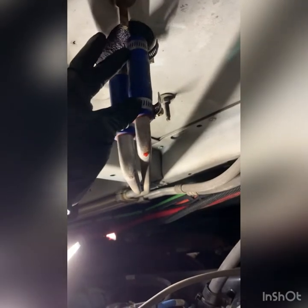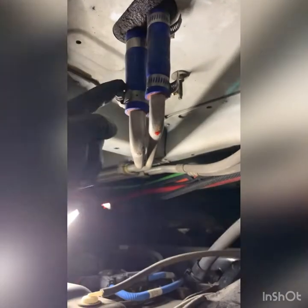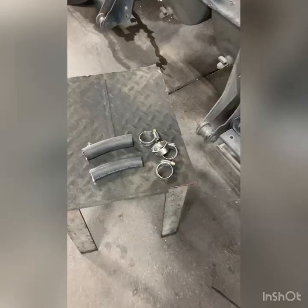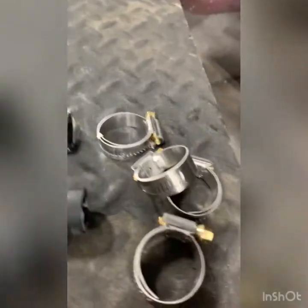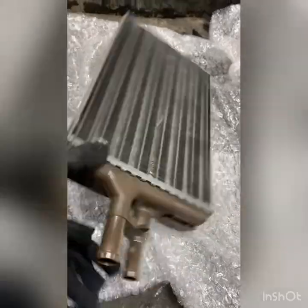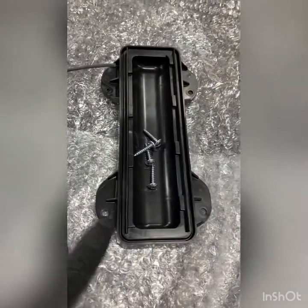We're going to go ahead and remove these hoses. We're not going to reuse them — we're going to get new ones, just because that's how I like to do things. Got my hoses right there. We're going to get new clamps too. So with these, loosen them up, cut them out, drop this down a little bit, and we'll make a little bit of a mess. I went ahead and cut the hoses and lubed them up, so it's nice and easy to get out of the hard pipe. What we got right here is a brand new heater core, new cover, and I got to put the seal on in this groove right there all the way around.